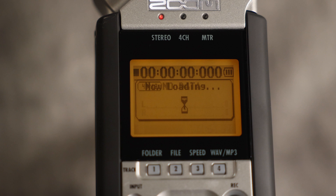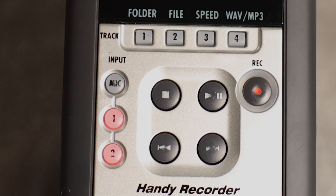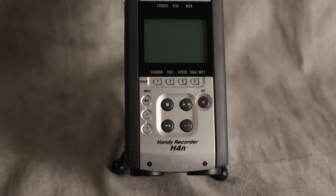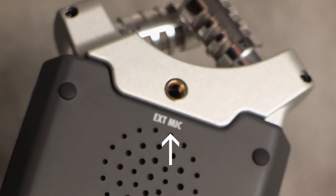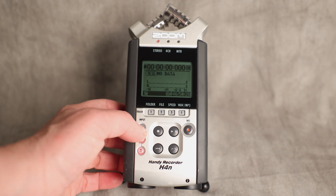Once it's powered up, the first thing I'd like you to do is select your mic inputs. You can either use the built-in mics on the top of the zoom to record, which is the mic button here, or you can plug in an external mic to one of the XLR inputs, which would be the one and two button here. Or there's even an eighth-inch jack up here, in which case you would choose mic and turn on the plug-in power if necessary in the input menu. I'm using the built-in mics, so I'll press mic.